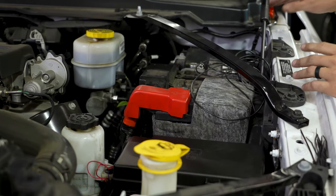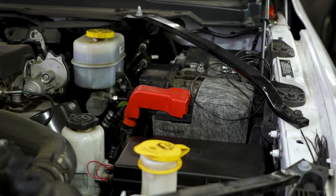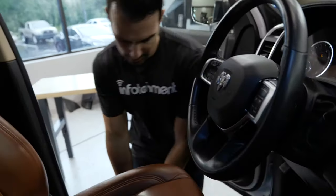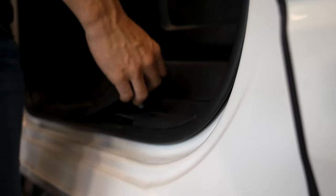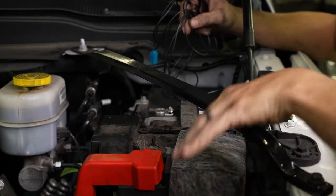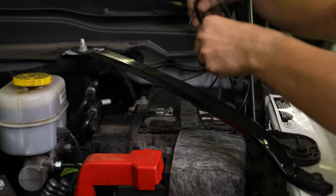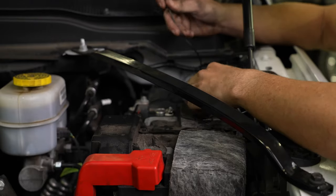After we've sent the wire down towards our firewall, we're going to go under the wheel well and route it through the firewall. The first step of taking the wires through the firewall is to remove this little kick panel right here — just go ahead and pull straight up. Once we've made it past the fuse box, we're going to route this wire around the battery box and down into the fuse box, then through the firewall into a grommet.